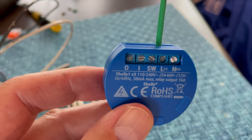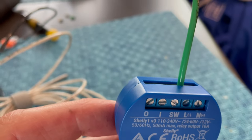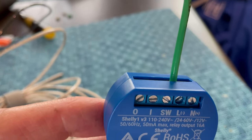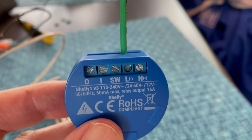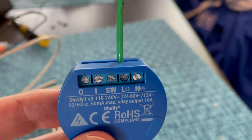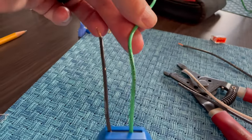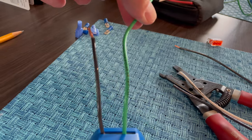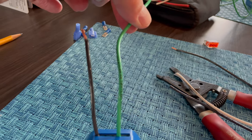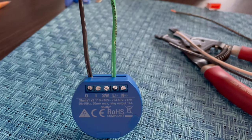Since there is no code for wire color in 12-volt systems, you can use any color you want. In my case, I used green wire for any 12-volt negative connections, black wire for the 12-volt positive connections and the load connections, and white wire for the connection to the switch. The O wire will go to the load, or the actual light fixture. It will eventually have a male spade connector attached that will connect to the wire that was connected to the lower post of the switch.